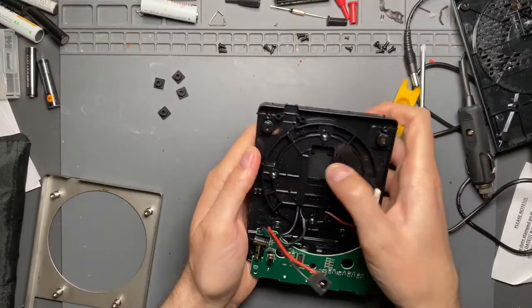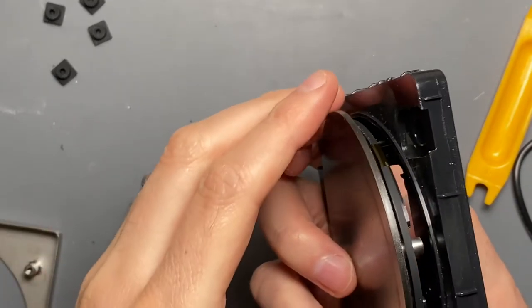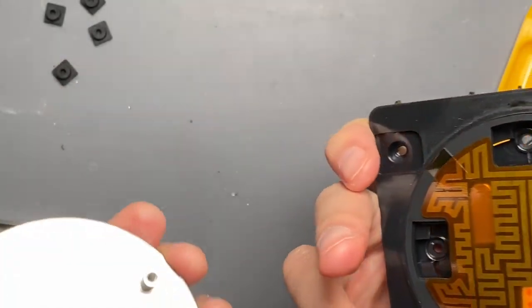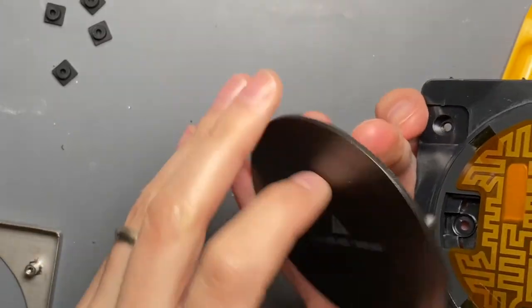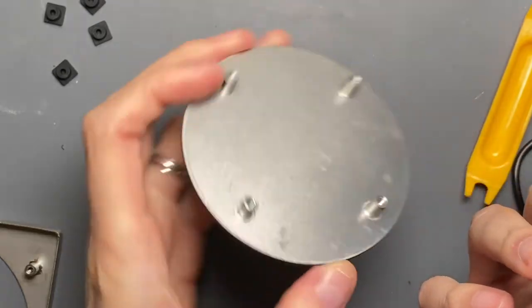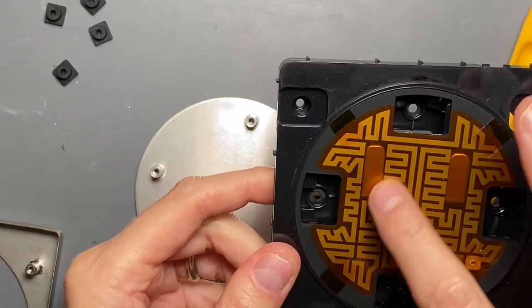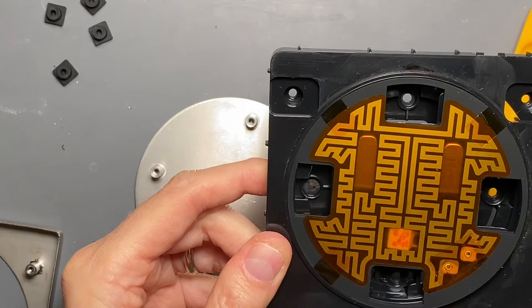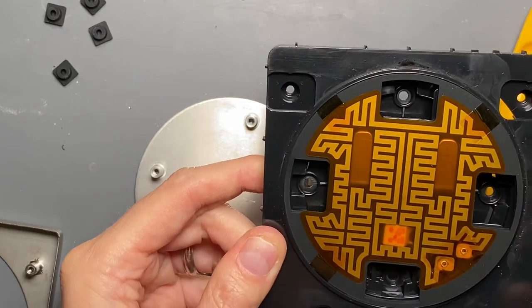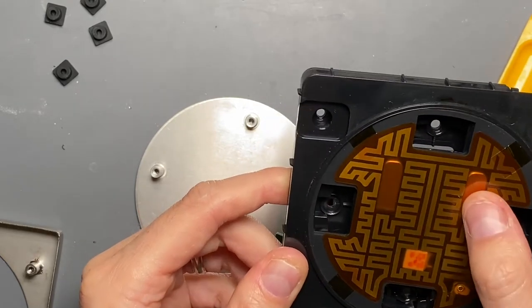I just thought - what if I press on the middle here? And it came off. So now we can see in closer detail what's going on. Exactly what I thought it was - beautiful. There's an aluminum plate that acts as a heat spreader, with a nonstick surface. And there is that beautiful heating film - just traces running through there, low resistance, with PET film tape on both sides. It's concentrated around the inner circle, but it does what it's supposed to do.